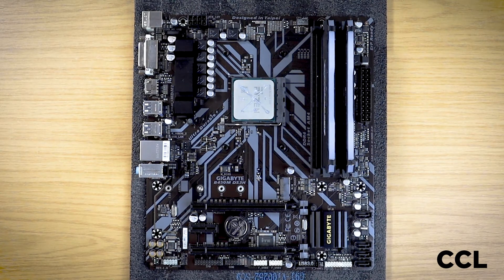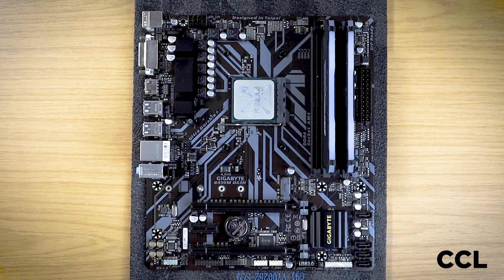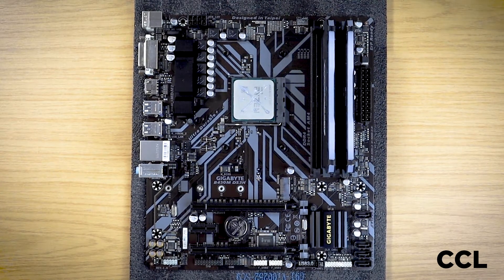You can put too much thermal paste on. It will actually create a thermal barrier between the CPU and the cooler and stop heat from being transferred out, and your CPU will continue to overheat. In this instance, that is just the right amount. Anything less than that, you're probably looking at not enough contact between the CPU and the cooler, and again your CPU will overheat. It is a balancing act getting the amount right, but once you've done it more than once or twice, you'll get to learn how much paste is required.